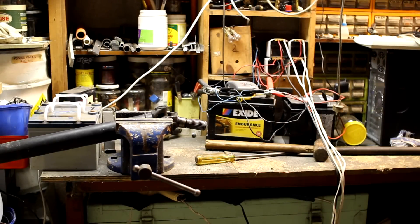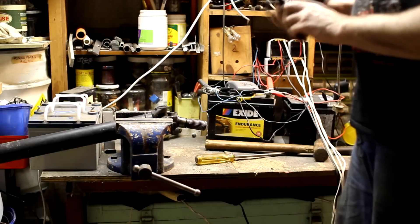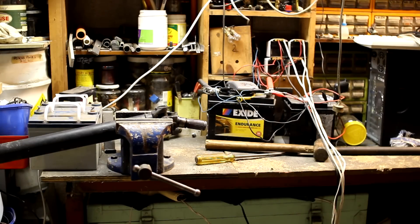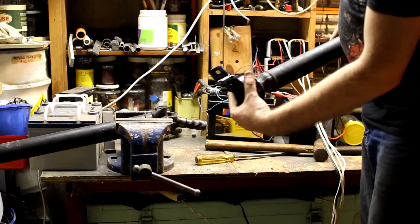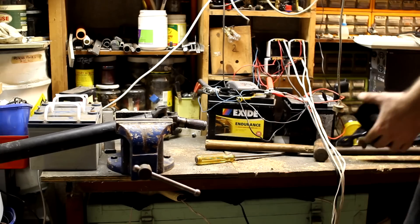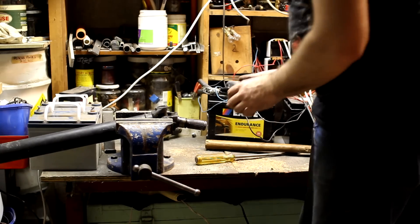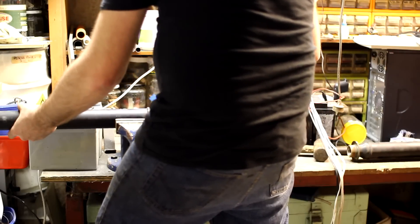And that's the new one — one piece, wonderful. Goes straight on like that. The splined piece here goes into the splined piece of the tail shaft, so you can't get it wrong — it only goes one way. The only thing you need to worry about is the alignment for the tail shaft itself. I'm going to switch this part of the shaft around so the alignment mark I left earlier is on top.